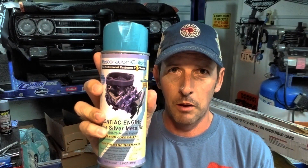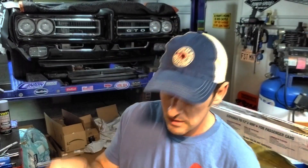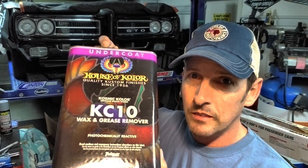First things first, get yourself some good paint. This is really good paint from Restoration Colors — they have every make and model, Mopar, Chevy, Ford, it doesn't matter. This is for a late '60s Pontiac motor. It's a high temperature enamel, and having said that, you're going to need some high temperature primer for your enamel. This is not a well-known fact but it's always recommended to use primer because it helps the enamel color stick to whatever you're painting. Other supplies: rubber gloves, a fresh razor blade — not a used one — three-quarter inch masking tape, inch-and-a-half masking tape, and a toothbrush.